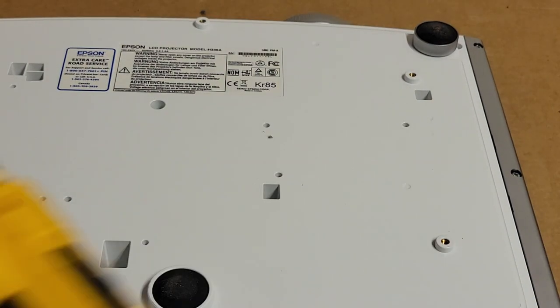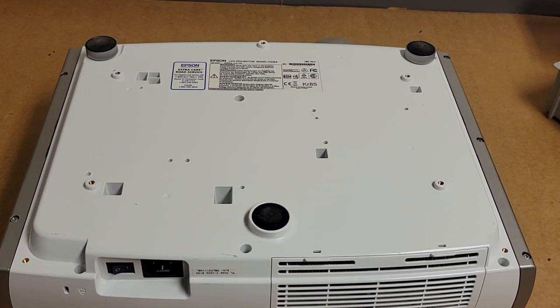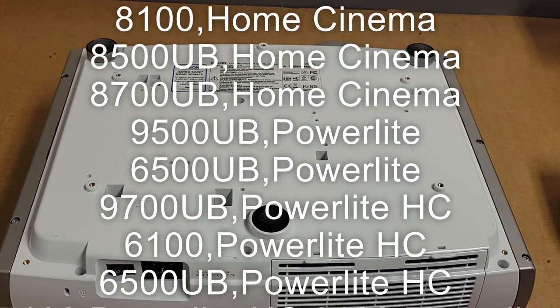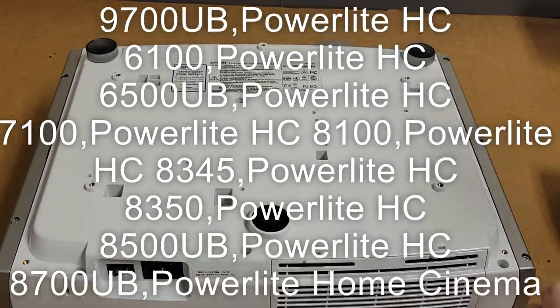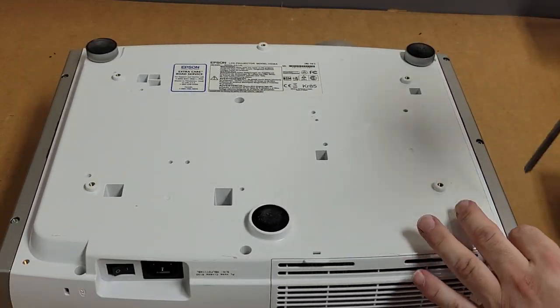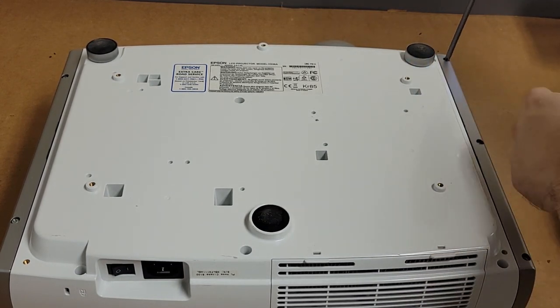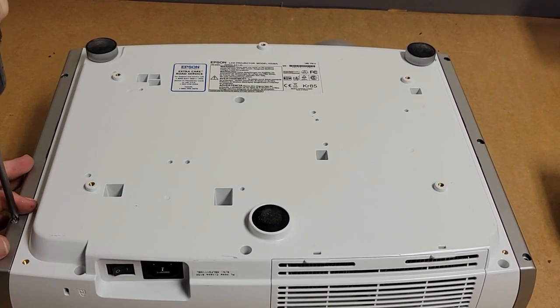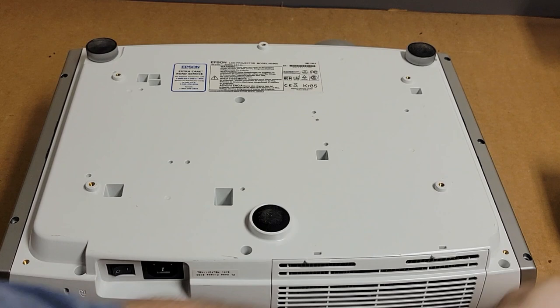So this chassis is common across many Epsons. Let's zoom it out a little bit so you can see better. This chassis is used by the 8350, 8300, and a few others. I'll put something down in the description for all the chassis that this matches up with. And to take these apart, you have to take the sides off first. One, two, three. And then one, two. That'll release the sides.